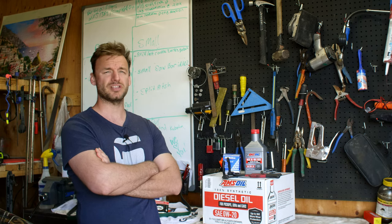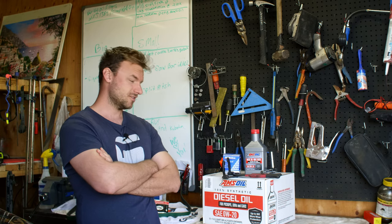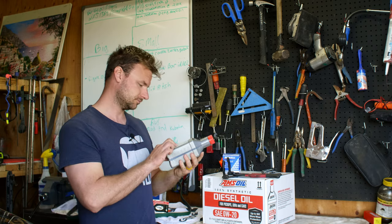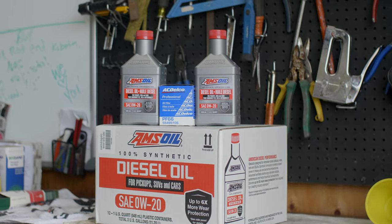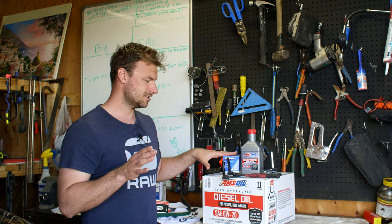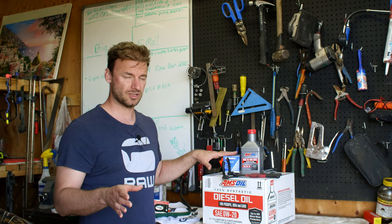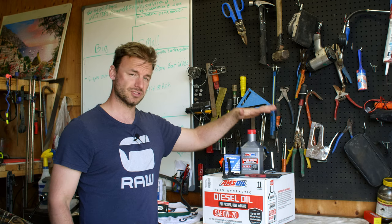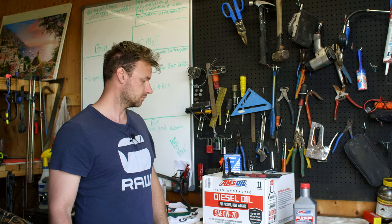You can do your own oil changes on these trucks. They sold him the wrong oil originally — even the dealers don't really know what's going on. This truck takes 0W-20 and it needs to be the Dexos D — has to be the big D Dexos D, that's the oil spec. To my knowledge there are only two places to buy it: AC Delco makes a 0W-20 that meets the GM spec — it was $63 a liter in Canada. It calls for seven US quarts, basically seven liters. We shopped around and Amsoil's got it for about $12 or $13 Canadian, it meets the spec, and we ran it by the dealer and they're okay with it.